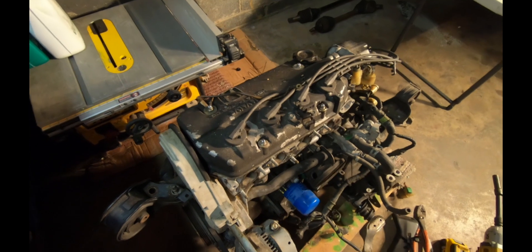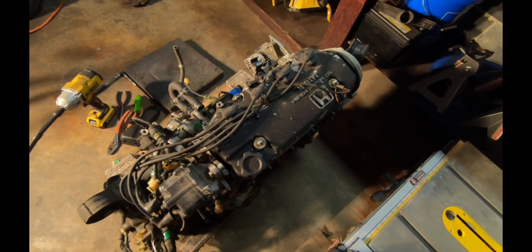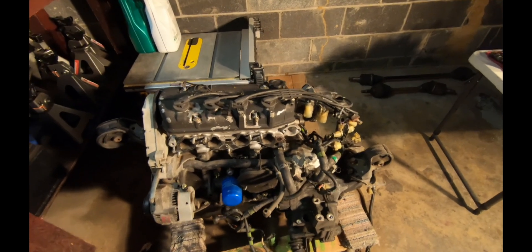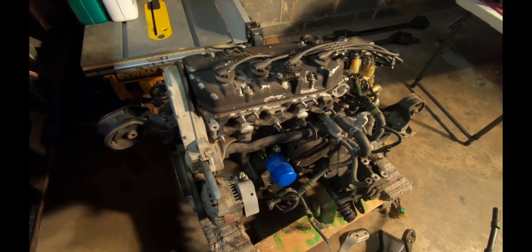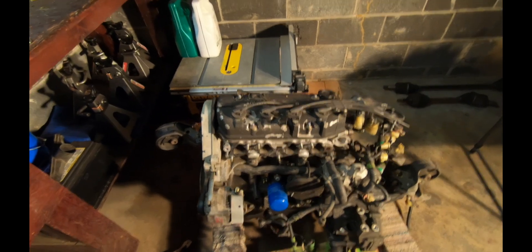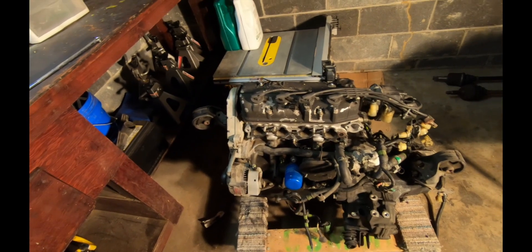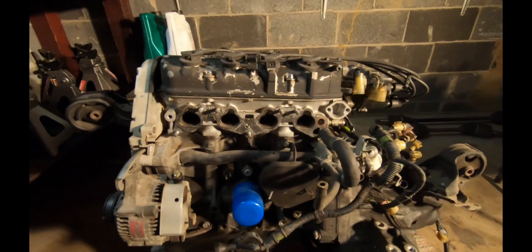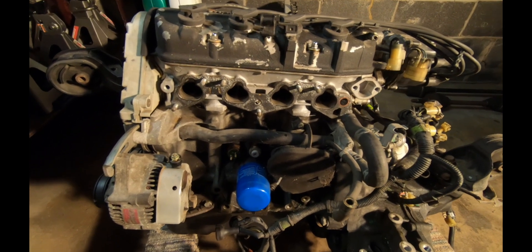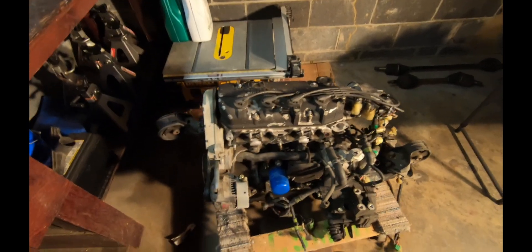There are a few reasons I stuck with the single cam. In my opinion, these single cams are very reliable, very underrated, and very sourceable — in the fact that you can still find parts and have things delivered next day in case anything happens. It's not a completely dinosaured-out abandoned single cam. I prefer to put what belongs in there, and I think that's the A6, which comes out of any '88 to '91 Si CRX or hatchback. The all-wheel drive wagon also comes with an A6.